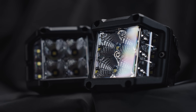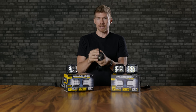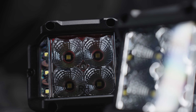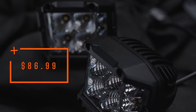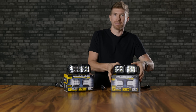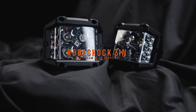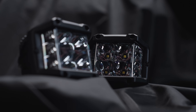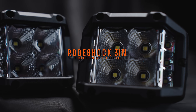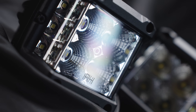This is the better. This is still the same size pod light — it does look a little bit bigger, but they still call it the 3-inch pod light. The only real difference from the ones we just saw is that it has this additional flood lighting on the side, and it's pretty bright. These came out to about $89 when I purchased them, so they're substantially more expensive, but they also come in a pair. At Harbor Freight they had a spot beam pattern and a flood beam pattern, but there was more like a low beam and a high beam. The RoadShox spot boasts 2,090 lumens with a 6,500K daylight color temperature and draws about 50 watts, with long-distance coverage of up to 960 feet. The flood light shows 2,120 lumens with a distance coverage of 590 feet. They all have a high-impact polycarbonate lens and are IP67 rated.